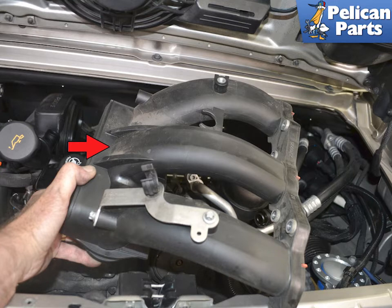To replace the high pressure fuel pressure sensor, you will need to first safely raise and support the vehicle. Then you will need to perform a partial engine drop and remove the air box and throttle body. You will also need to remove the resonance tube and the bank 4-6 intake manifold, indicated by the red arrow. Please follow the link provided at the end of this video for additional assistance with all of those tasks.